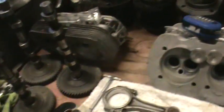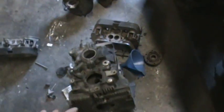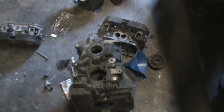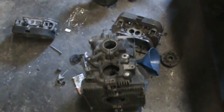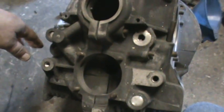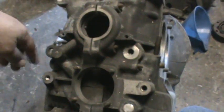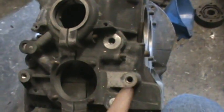I dug up a couple of cams. I got two sets of heads here, got this crank assembled. I got a bus case here. A couple people wanted to know what the difference was between a car and a bus case. If you have an early bus, pre-68, it's not really a problem — your mounts are on the transmission like a car. It has actually like a saddle, like Darren's bus, Musty One. A bus like mine, 68 to probably 72 — 71 was the split year when they went to the type four motor — takes a mustache bar, and the bar bolts to these bolt holes right here. So you have to have a provision on the case to bolt them on.